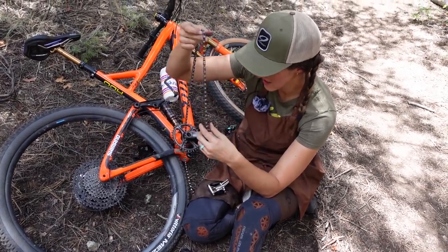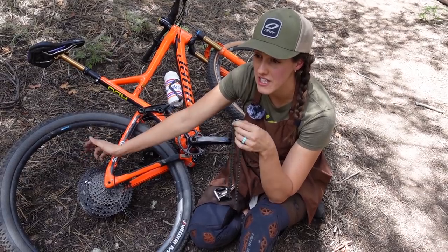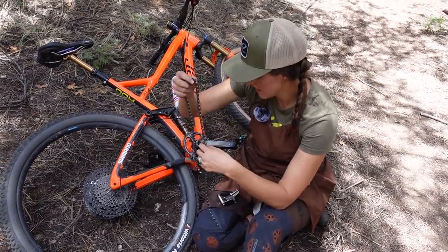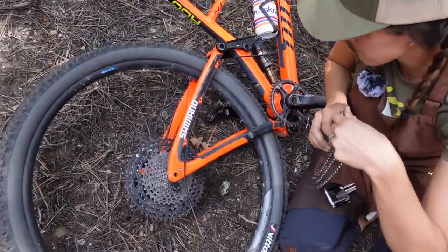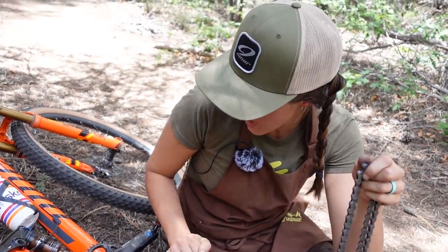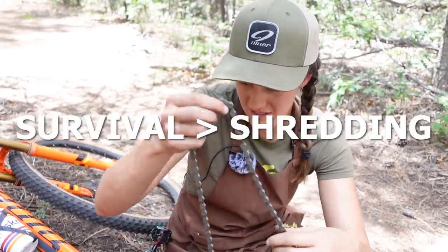Step one is you have to pick a gear. Unfortunately if you have a lot of climbing left you cannot just pick your biggest gear. If you have a lot of steep climbing and descending left and you know you're not going to be able to do it in a middle gear, just start walking. You have to pick a gear where your chain line is going to be more or less straight. And a few disclaimers: you cannot do this on a full suspension bike and ride out normally. Your chain line gets longer when you compress your suspension, so if you go off a drop you will just break the chain again. This is a survival mode fix — you are not going to be able to shred. Survival over shredding.